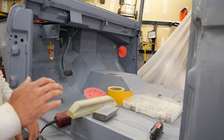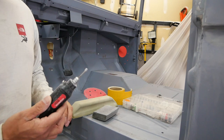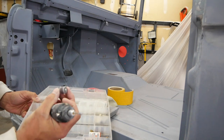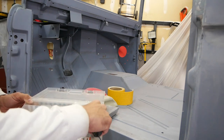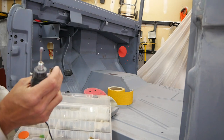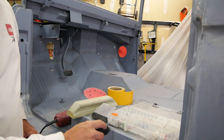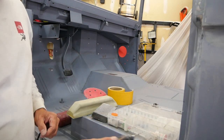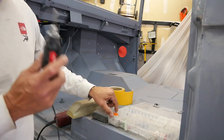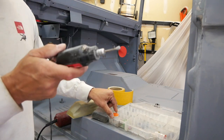A DA works extremely well on flat panels to get the shape right. My favorite tool is a Dremel with a box of various tips — especially the cylinder sanders where I can replace the ends with a small 80 or 60 grit sleeve for getting into all the nooks and crannies where body filler has gotten in that I need to shape out. This thing works like magic. I'm also going to use it to work the gap back in the taillight housing that I filled with filler.